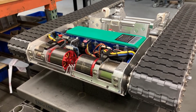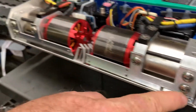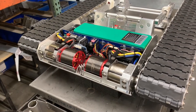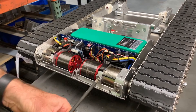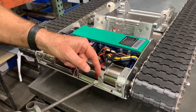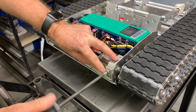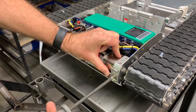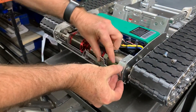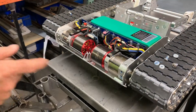So if you've just taken your cover off, this is probably what it's going to look like. Make sure that the set screws are still in the holes — there's one there and one over here — and these brackets are still on. We're going to remove those right now. I'm going to take a big Phillips screwdriver and remove all three screws on both brackets. You'll notice they have Loctite on them and there's a little plastic spacer behind there — you want to make sure you save that plastic spacer. My plastic spacers are right here, three of them.